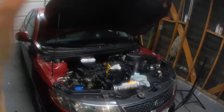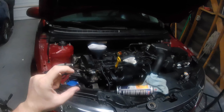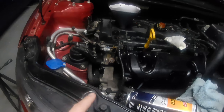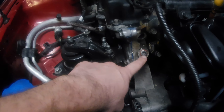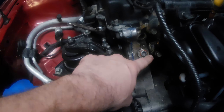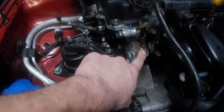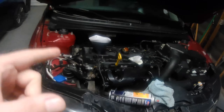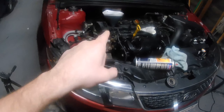Also in the last episode, I ended up dropping out the bottom of the engine, trying to see if we could end up cleaning out a filter I have in here for the variable valve timing solenoids. What I didn't show you guys — I finally got this screw out. What I ended up doing was hammering in a triple square drive bit, heating it up, hammered that in, and then just broke it with a breaker bar, kind of bouncing the breaker bar. Finally it popped loose, got in there, sprayed it down. Don't think it did anything. I feel like I wasted two days trying to get in through that thing.